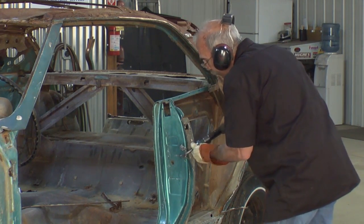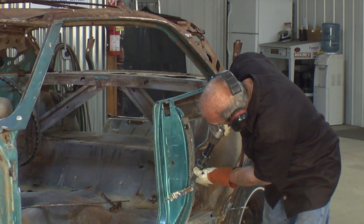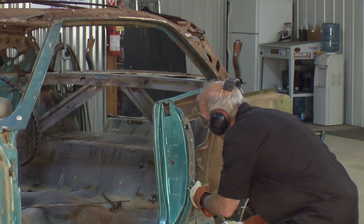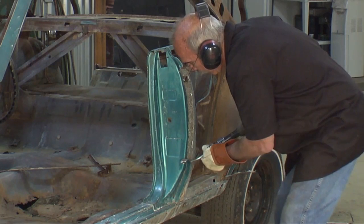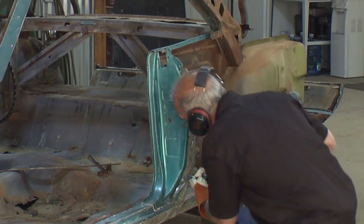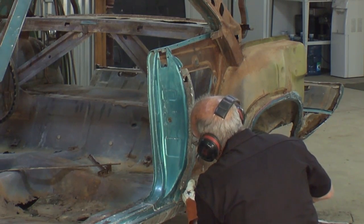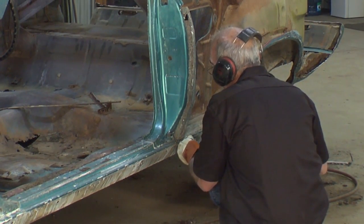You're just going to have to play with the chisel, but I'm telling you it's a great tool. If you notice right there — General Motors didn't have that car welded very well right there, but it happens. Now it's like butter. Approaching the bottom of the door jamb — you can see it's the same as the rest. I'm just using the chisel to come around the spot welds and that will finish it up. Single plane metal comes off every time.